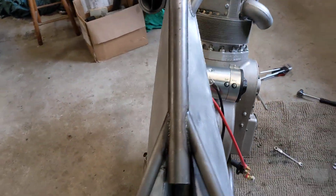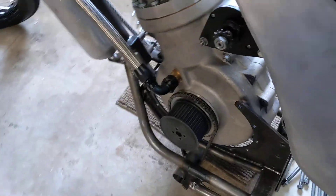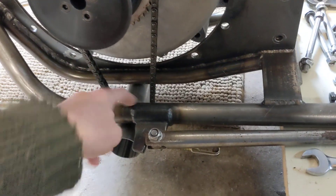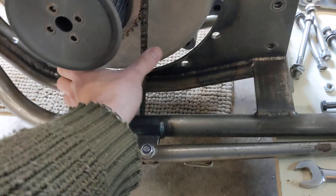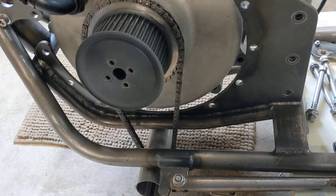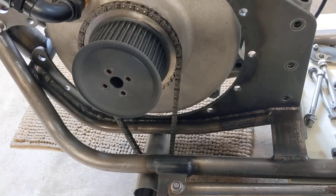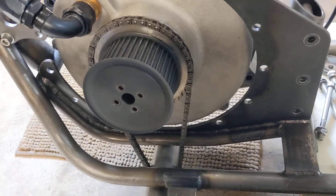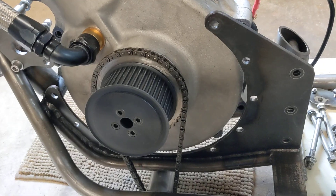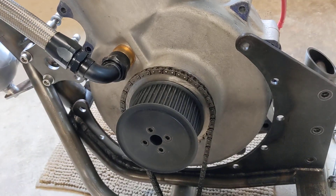So I came up with an ingenious idea of using the chain that would normally go to the Dynastart. That chain is under the frame with a bit of pipe keeping it under tension. It allows the engine to lean away to a certain point and then stop. It won't damage the chain because it's a static weight with no big shock load, and it's quite stable — I could probably push the bike over before I'd push the engine out of the frame.